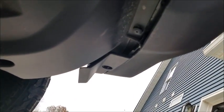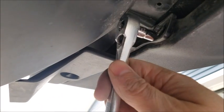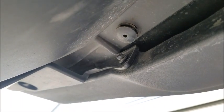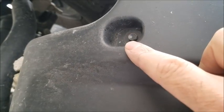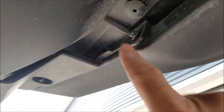I've run into a little issue: my ratchet and socket doesn't have room to get up in there and reach that last bolt — there's not enough space to back it out. And I don't have a seven millimeter wrench; the smallest I've got is an eight millimeter. If I had a seven millimeter wrench I could just run that out and be done. But because I don't, it looks like I'm going to have to take the whole air dam off, which means removing all the plastic clips along the bottom and bolts on each side — that's probably going to add another five minutes. If you have a seven millimeter wrench, you can skip this whole step.